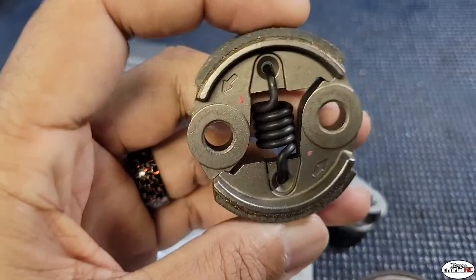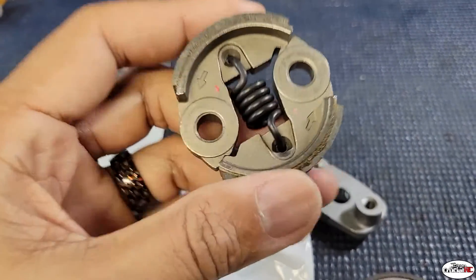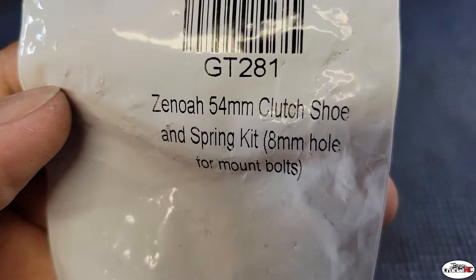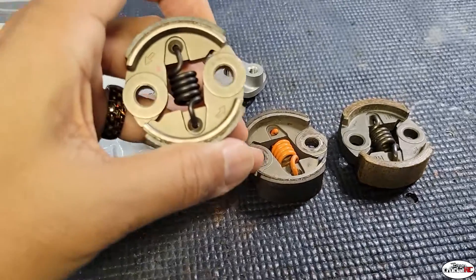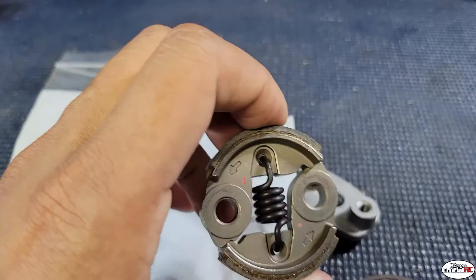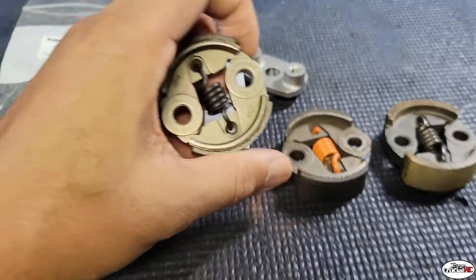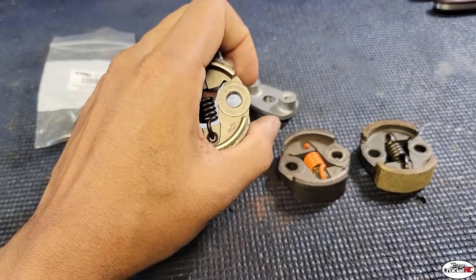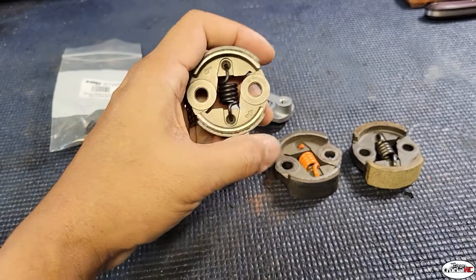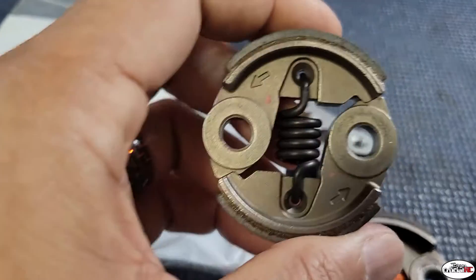This is probably the clutch most people are familiar with — this is a genuine Zenoa clutch, straight from DDM. This is a 54 millimeter clutch. We're talking about all 54 millimeter clutches here. You can also have 62 millimeter clutches — those are the two sizes for small block engines for the most part. Of course you can make things work; they make 70 millimeter, 80 millimeter, and Taylor RC also has a 110 millimeter found on 80 Supremes. The stock Zenoa has an 8 millimeter hole for an 8 millimeter bolt.